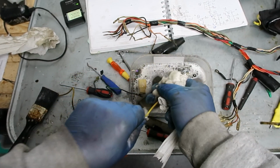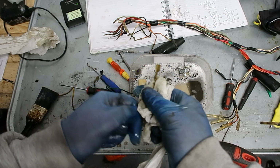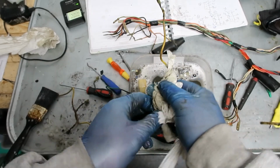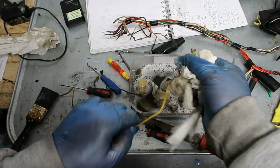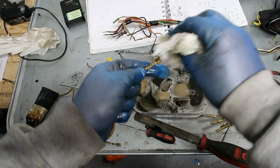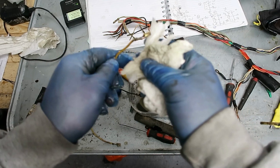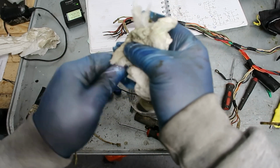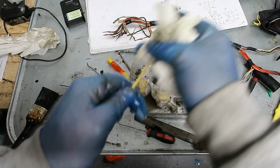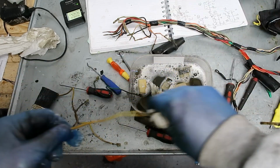Again, you're just looking to see if there's any hardening of the wire, any indication that there might be a holiday there, or a gap. If there is, you just need to change the wire. But get them clean, if there's rust on. And what I do is when I reassemble it, I use a little bit of silicone grease, just to add a bit of additional insulation protection.